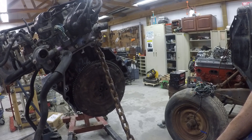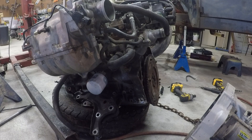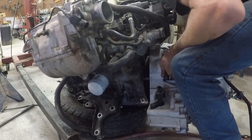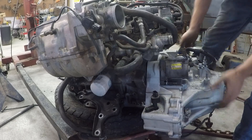If I did this right, I should be able to set it on the ground and mate it up to the transmission using the plateless kit. Since I've had this mated to my H before, I don't need to drill the hole again — but I do need to drill the half-inch hole through the starter on the transmission side. Then you take your bolt, shove that through the transmission, and wrestle this thing on. I'm pretty sure it goes through this hole right here.